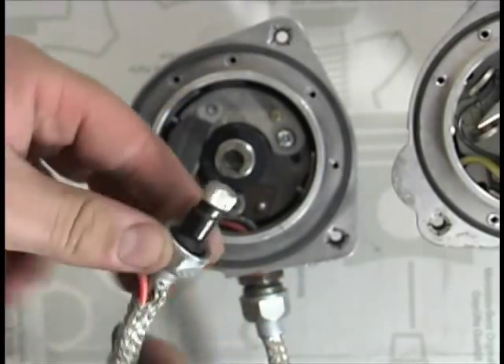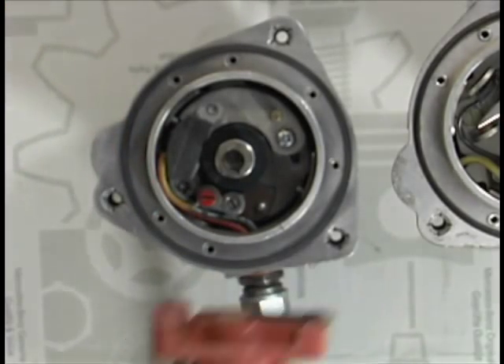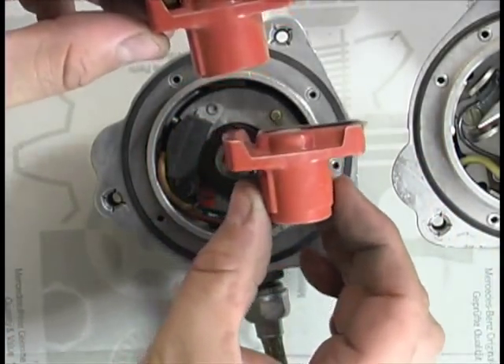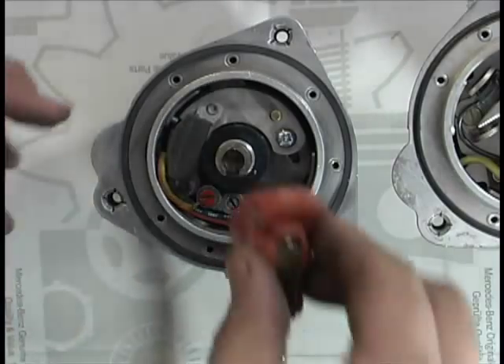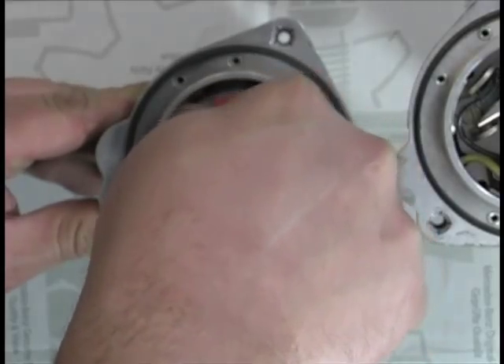This one is ready to install back onto a military coil. The base of your rotor must be shortened in order to fully seat onto the top of the distributor shaft. Here at our shop, we use a belt sander and simply machine off a little less than an eighth of an inch off the bottom of the rotor to install it down on top of the magnetic ring.